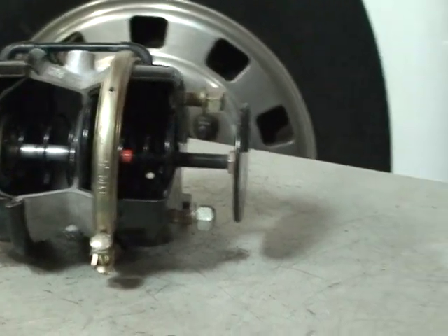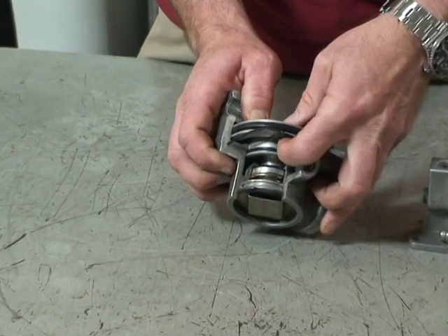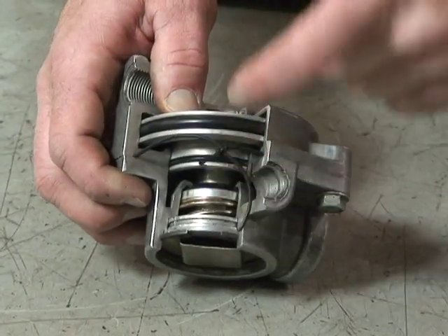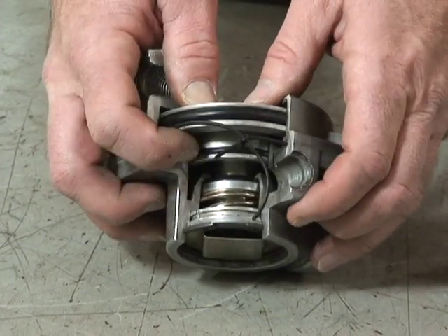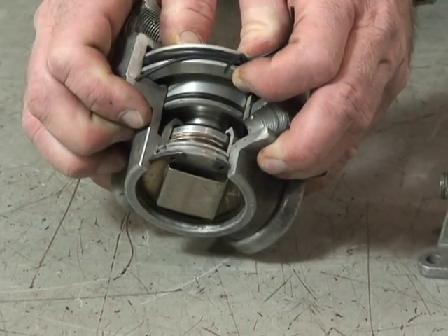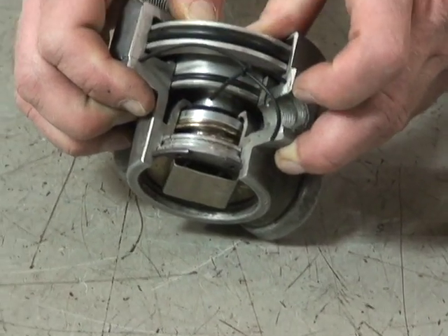As the air comes through here and opens up, it allows air in on the supply. As soon as we get the equivalent pressure on the bottom of the piston as what's being applied on the top, the piston goes into a state of balance. The intake valve down here closes and we go into a state of hold.